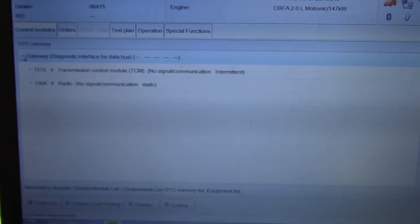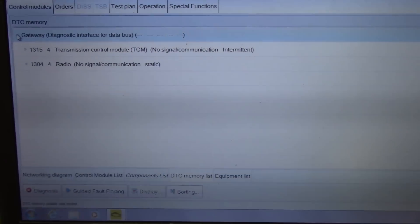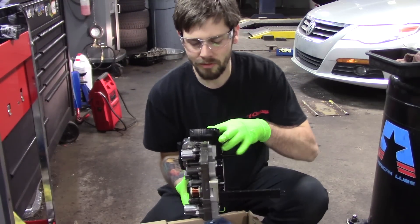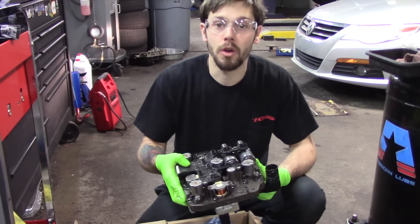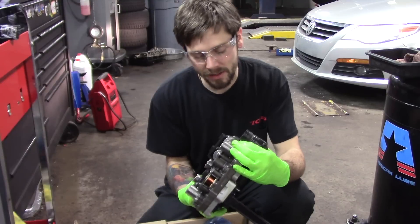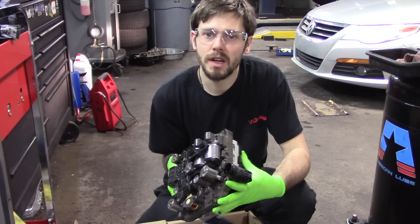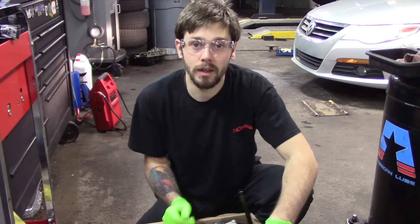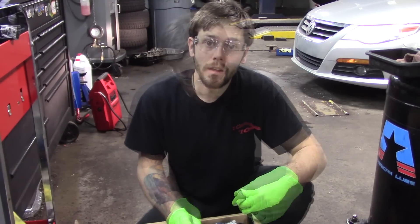Alright, real quick guys — just want to show you the gateway. Transmission control module no-comm is now intermittent. Vehicle is running right now, it shifts out of park. So I'll show you the old mechatronics — bunch of solenoids on the front, a couple valves in here, I guess it is a valve body, and the module on the back side. So this is the old one. The vehicle is fixed — you can hear it running behind me. The powers and grounds were good, we had good network resistance — 58 ohms, spec is 60, that's close enough for me. I showed you how to set the fluid level. This one is fixed, no faults, all cleared. I just have to road test it, do basic settings for the steering wheel light and traction light which will go out when I drive it — that's from the battery dying. Hope you guys enjoy this video, thanks for watching.